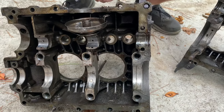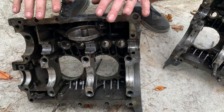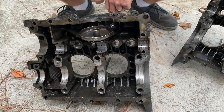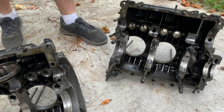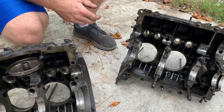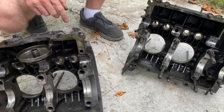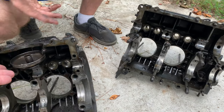This case is now garbage. It's magnesium — this is an old factory AS41 magnesium case. If it were aluminum you could probably have someone re-weld and machine it down. But even then, as cheap as these cases are relative to the cost of custom repair work, it really doesn't make sense to fix it.